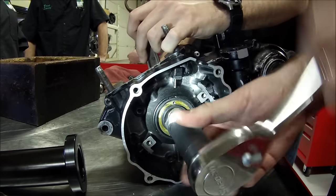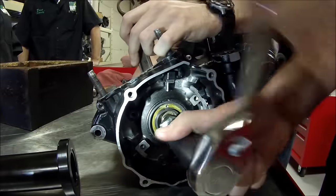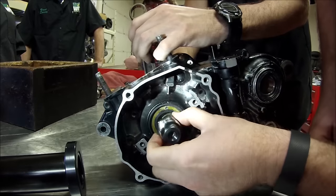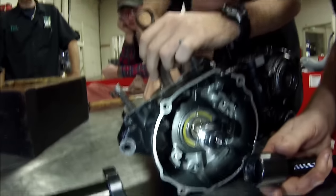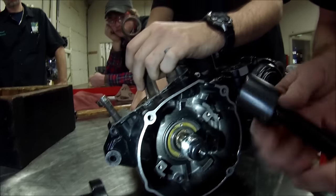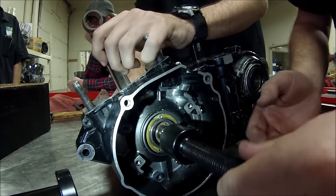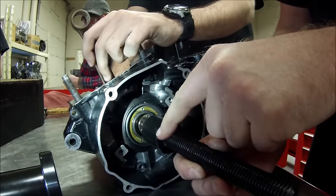I want to use up all the threads I can — I want maximum support. We cannot push this crankshaft into this engine right now; it will not go. The service manual says to press it or use the appropriate puller. Now that we have this, we can go ahead. I'm going to put a little more grease since this is kind of new. We really like to make our tools last a long time, so we grease our pullers up. I'm going to go ahead and thread this one on — notice I'm not using tools, this is all just hand tight.